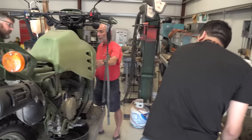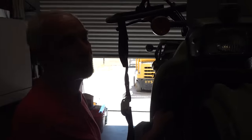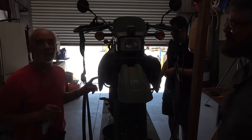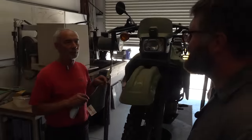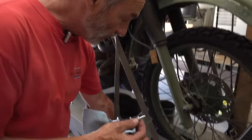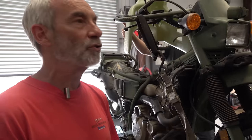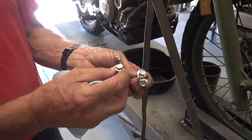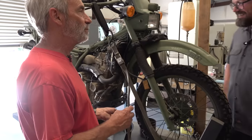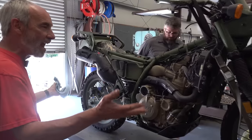The screws that go in here — these are stranger danger screws. If you get a screw too long, you're going to poke a hole in the tank and leak diesel fuel. So make sure you use the right ones. I can see right now someone has replaced these. These are not stock screws. And I see your fuel level's not that high, so I'm kind of on my toes — maybe they're down for a reason. All right man, we're getting down to the brass tacks.